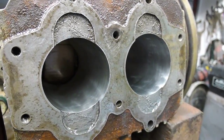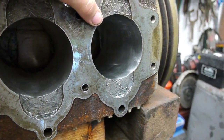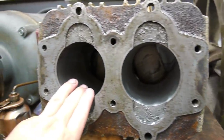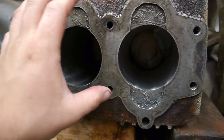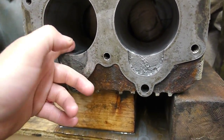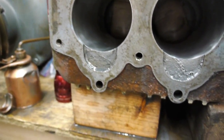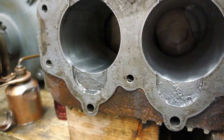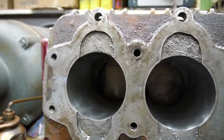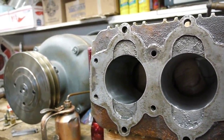It took about five or six minutes to do the first hole. I'm a little paranoid about going too far and taking off too much. Otherwise it's pretty much the same basic principle — just keep going at it. It's always good practice to actually stop the stone just as it's coming all the way out, then adjust the micrometer and loosen it so you don't mar any of the cylinder you just spent all that time cleaning up. If the stones are not locked in position when pulling it out, they could fly out — and you don't want that with how expensive these stones are.